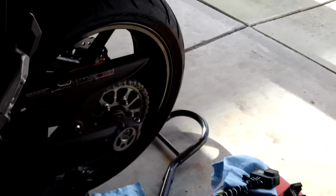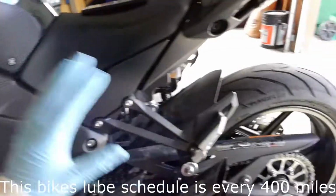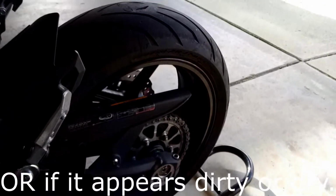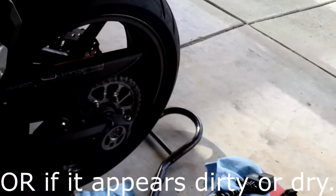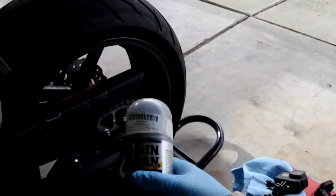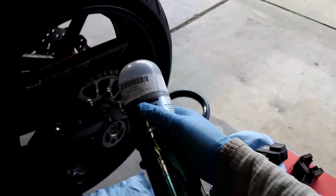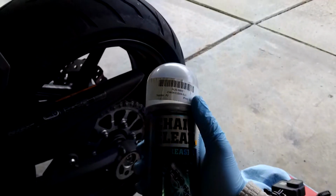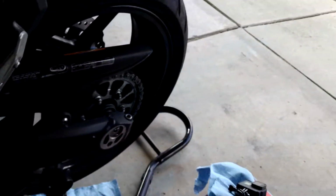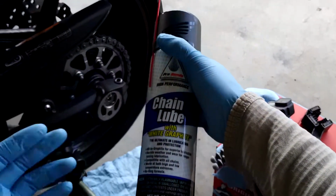I decided since I ran through the rain today I should do a bike maintenance, bike cleaning, chain clean video. Since my chain's a little dry and it probably got a little dirty. So I got my chain cleaner. I spray this on there, degreaser. Basically it rids the chain of all the old grease so that I can inspect my chain better, take a look at it, make sure nothing's messed up. I got my chain lube, which I'm going to apply after this stuff is off.